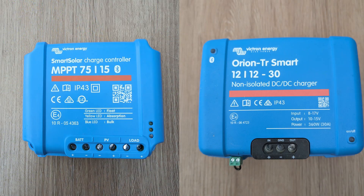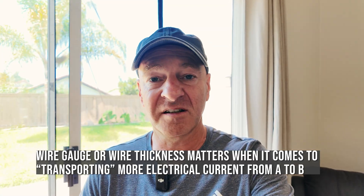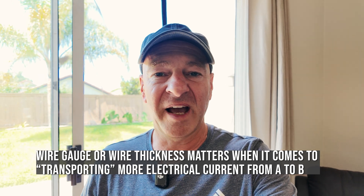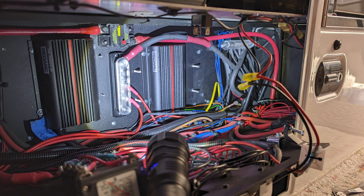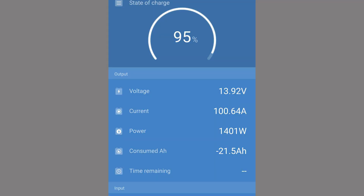I also needed more solar panels. I went to my off-road shop, Basel's Garage in Vista, California, and talked through my situation. Together with Basel, we designed a new electrical system. We decided to rip out the two Victron controllers — one for solar charging and one for DC-DC charging — and upgrade to significantly thicker wiring. We went with a Redarc system using two Redarc BC-DC-1250D controllers.